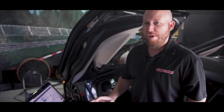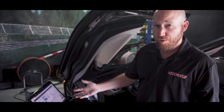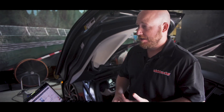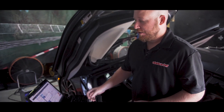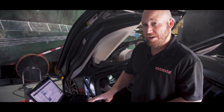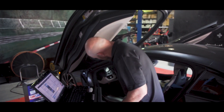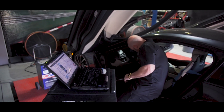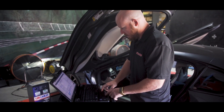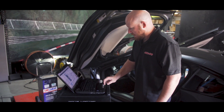When you flash any of the BMW F-Series, you need to make sure to write the coding back. The iFlash tool allows you to read your BMW coding and then rewrite it. Coding takes care of all your things — your windows, your sunroofs, and other features and functions that BMW has programmed. So it's important that before you start the car, you re-flash that. So before we finish our dyno pulls, we'll turn the ignition back on and write coding. Coding has been successfully written, so now we can close everything and start it up.